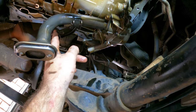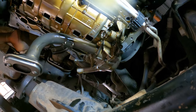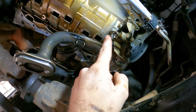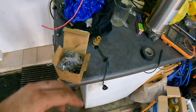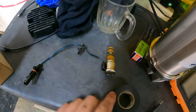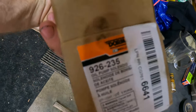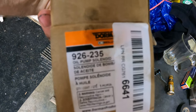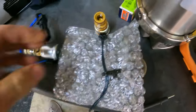All you have to do is loosen the pickup and these four bolts, and then the solenoid will just fall off. Now I'll show you the new one. My GoPro got a little oil drop on it — anyway. Old solenoid versus new one. It comes packaged from Dorman themselves, and I'll put the code and the Amazon link in the description. You can compare the two — they're exactly the same, obviously one is just cleaner.